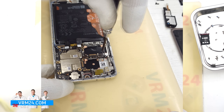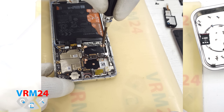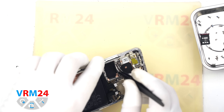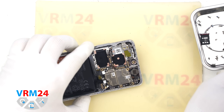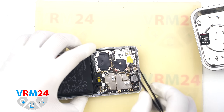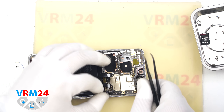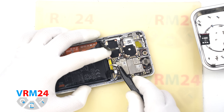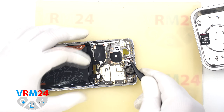There is one more screw to remove using the 1.5 mm Phillips screwdriver — this screw is different from the others too. Finally, we can remove the motherboard. Find a safe point to gently lift and remove it, making sure all connectors are detached. Lift it out carefully and set it aside.